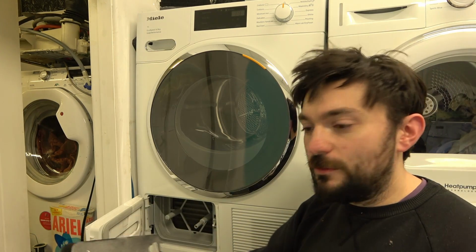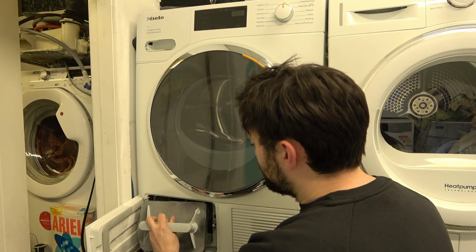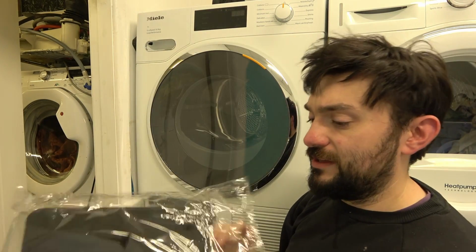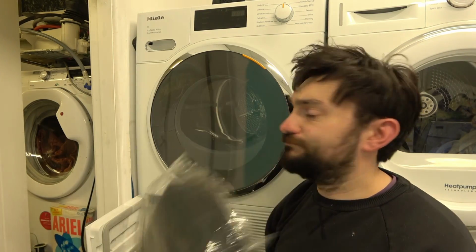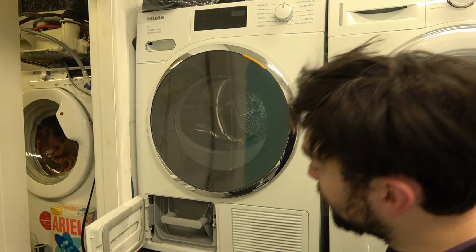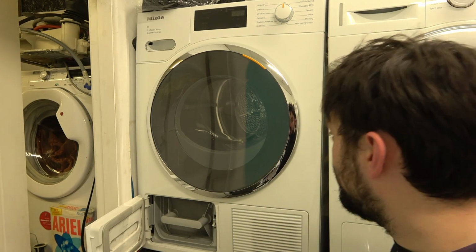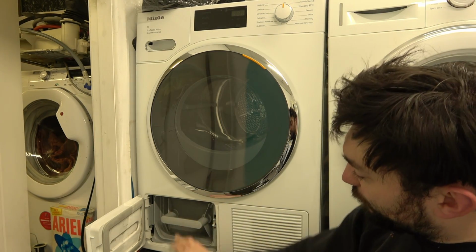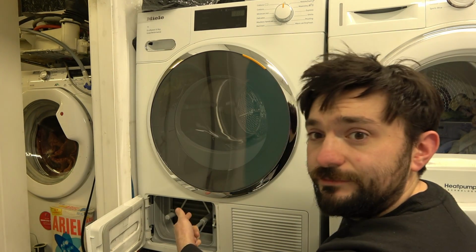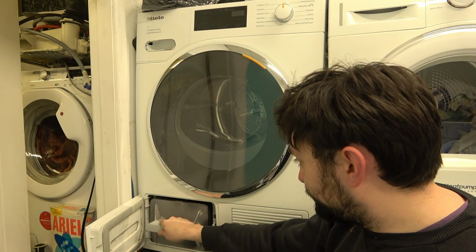And to be fair, I wouldn't bother hoovering that out. I'd just replace it. They are so cheap to buy nowadays that a pack of 3, for example, is less than 10 quid. Just go on eBay. They're not genuine, but they don't need to be. All they need to do is catch the remnants that bypass the filter before it hits the heat exchanger inside. And of course the heat exchanger in there is completely clean.